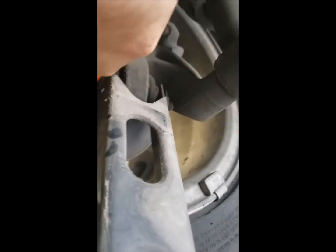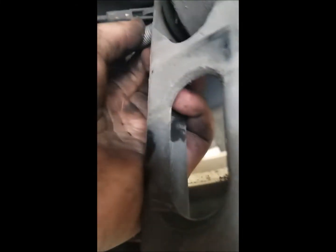Once it's out, it just drops right down. Now for the bolt on the control arm. The nut on the other end is locking, so there's no reason to hold it with a crescent wrench. It's just going to take some coaxing. And voila — one side is done.